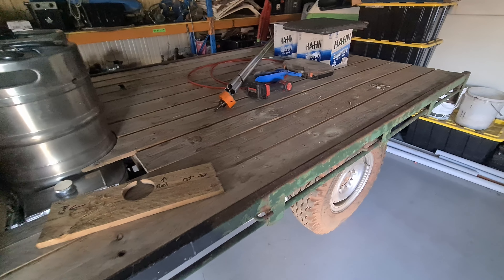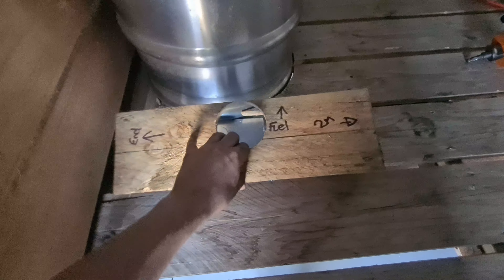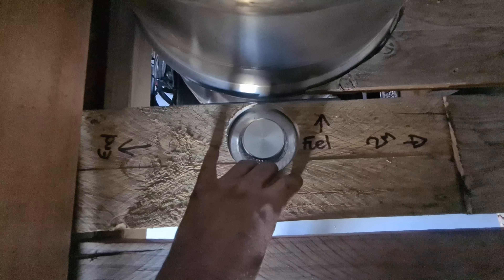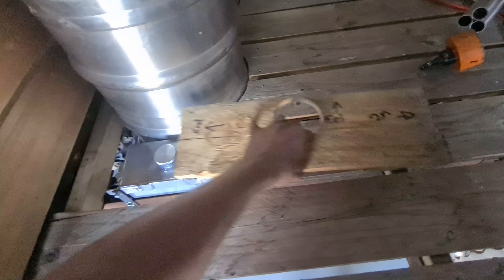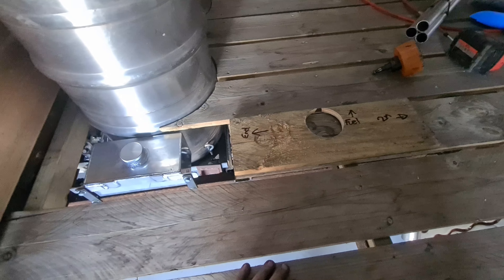Before I go buy some new wood, I figured I'd use this as a template to work out the spacing. I flipped it over, cut a little bit off the other end, and now it fits in there nicely, reasonably centred. Then when I get a new board, I can just put this one on the end of the new length, line it all up, put the saw straight through, and then screw it down. I'll go grab a board and then do that.